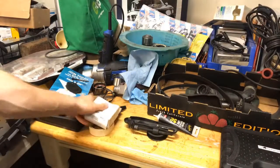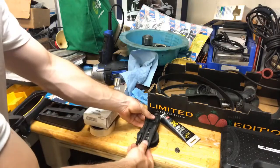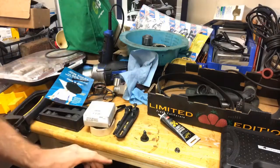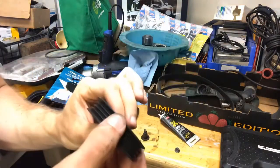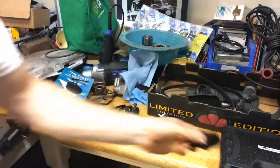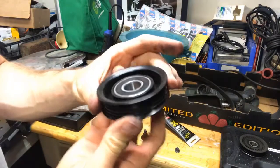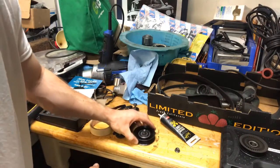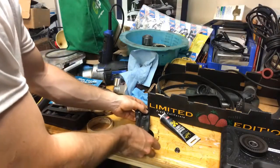Here's our new idler pulley — it's very simple to install. You completely remove the lock nut, the old pulley lifts up and away, then you lift up on it to expose the little post that holds it to the bracket. As you can hear, the old bearing is making a lot of noise — that's garbage. You could potentially replace just the bearing itself, but it's a lot easier to just replace the whole pulley. This is a Gates pulley, high quality, so not really concerned about it breaking. We just seat this into there like so, keeping things organized over the mounting point.